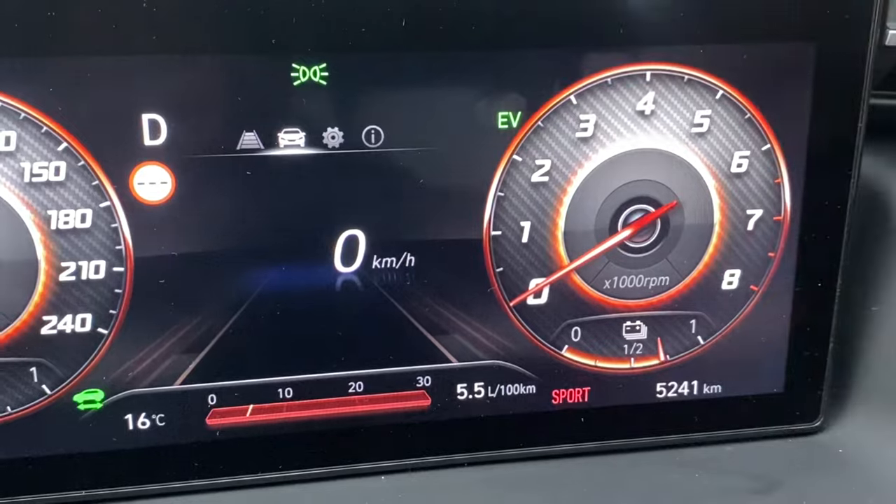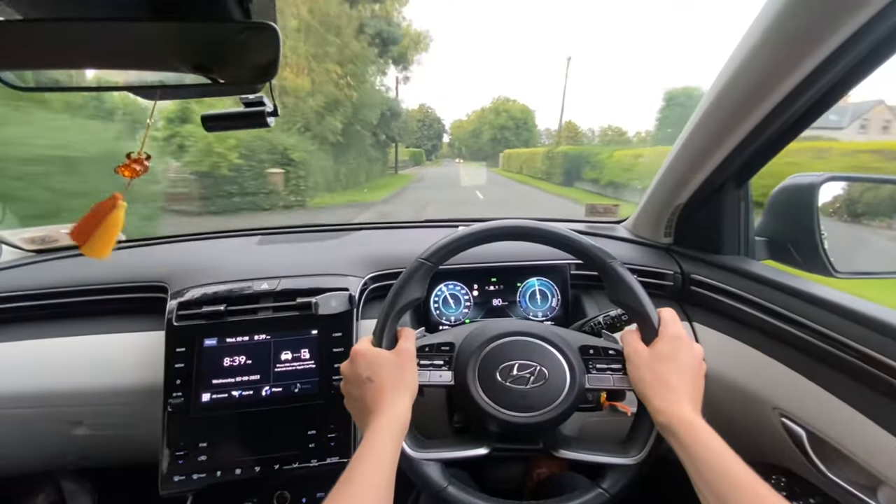The light should then extinguish. This is in your manual by the way — if you want to read about it, it comes under 'Exhaust System GPF Warning Light.' What it says in the manual is basically over 80 kilometers an hour, about 30 minutes, and stay in third gear with the engine revolutions between 2500 and 4000 rpm. That's the official guidance, though you mightn't have to stay strictly in third gear — but officially, third gear with engine revolutions between 2500 and 4000 rpm on a manual.